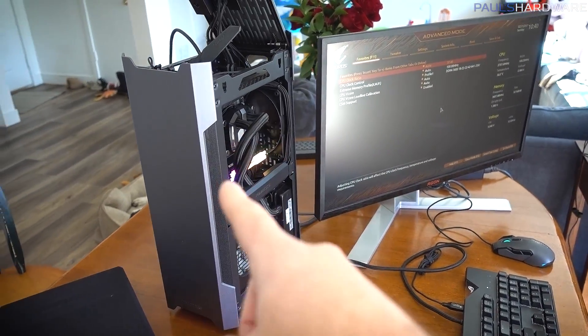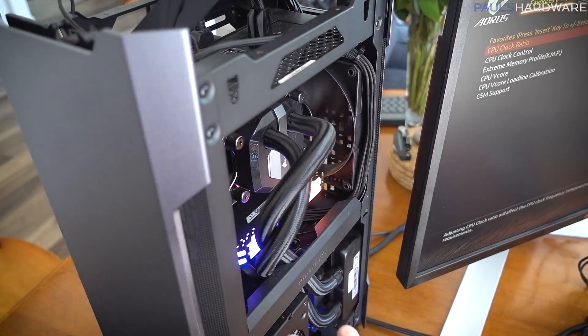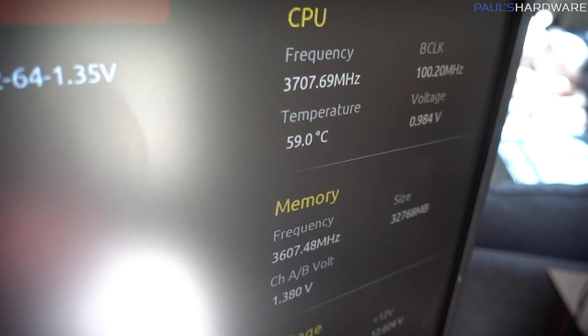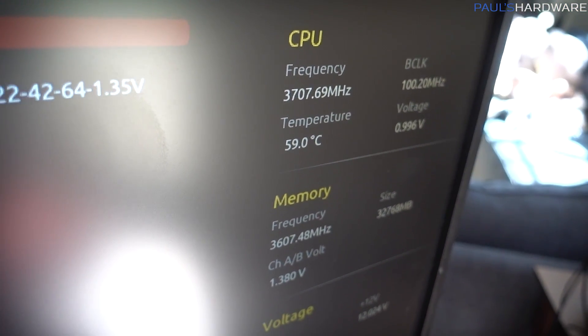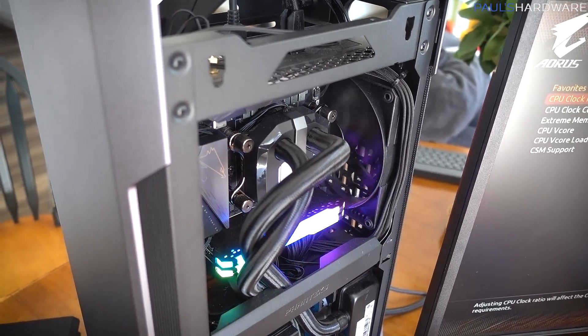For any of you with an AIO CPU cooler — if you ever have your system just shut down out of nowhere, check this out. Make sure you shut down the system, wait till it cools off completely, then boot it up just to get into the BIOS and watch the temperature climb hotter and hotter. And this will keep going even though the computer's not doing anything. There is no significant load on this system generating that amount of heat — it's just the fact that it's not being cooled by the failed AIO.